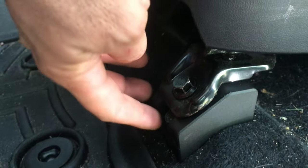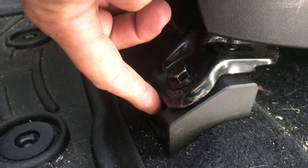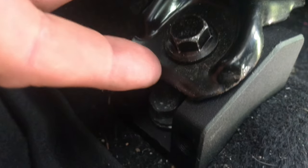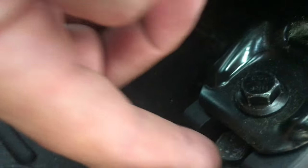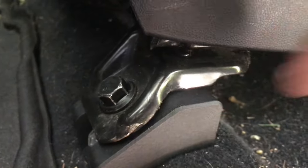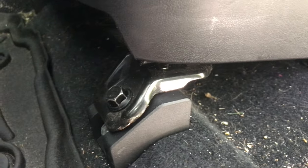Then go ahead and insert the spacers — put the spacers on first, then tighten down the 14 millimeter bolt. Do that first before you put the seat down, because you won't be able to get your socket under that lip, the seat frame bracket. Once those are snugged up, you can put the seat bracket over the spacer — there's a little spiny thing that goes down inside it, like on the stock. Put in the 14 millimeter bolts, tighten them down on both sides, go to the rear, and do not forget to tighten down the rear bolts. Then put the little covers back on.